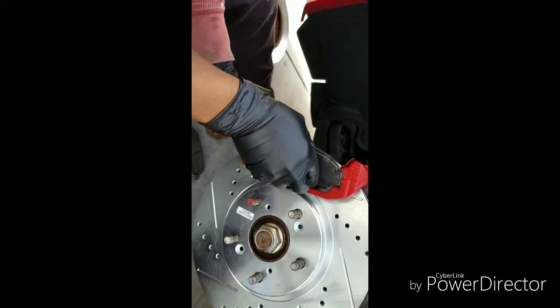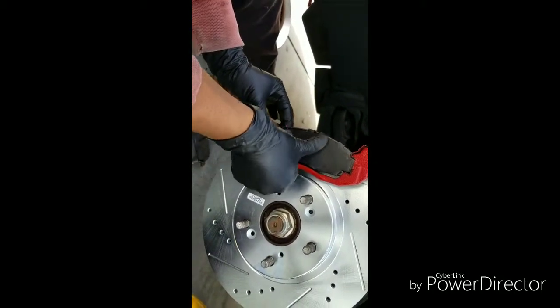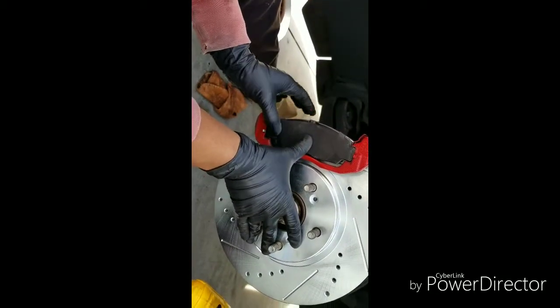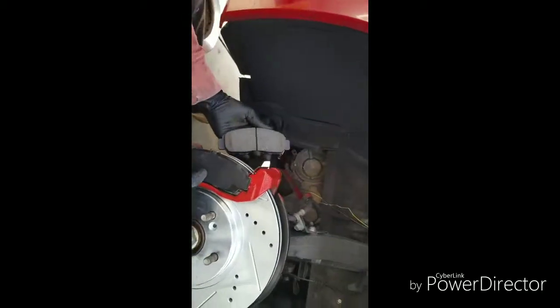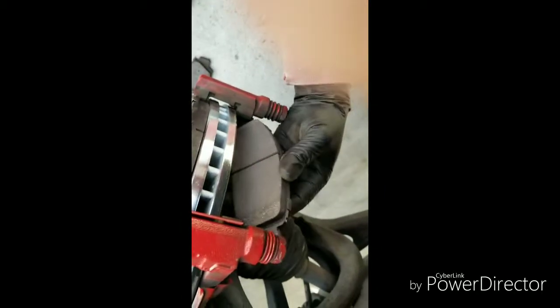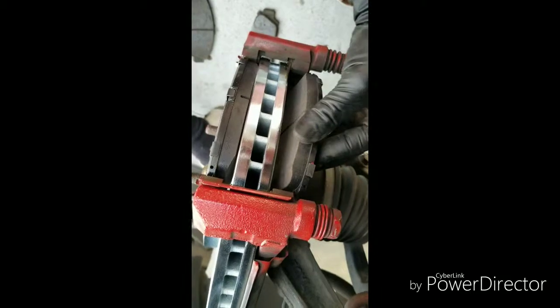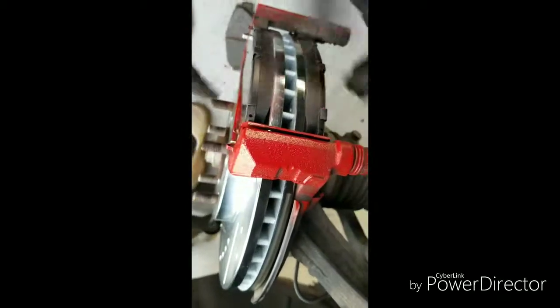The clip pad came out. So put it in at an angle, and then with your thumb, push it closed like that. And that's it. Make sure that's on flush. And do the same thing with the rear. Put the bottom in at that same angle. Make sure it's in there, and then squeeze it. Just like that. And that's it, folks.